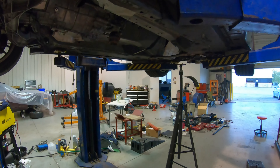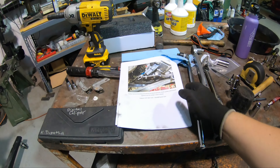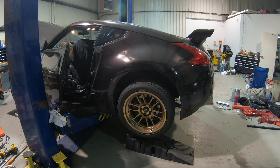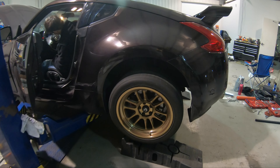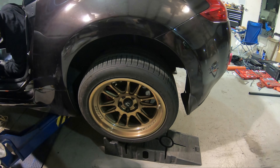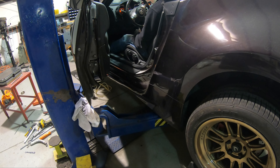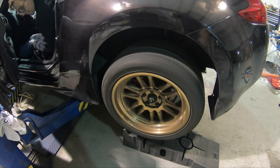Everything is tied up and connected. I zip-tied the harness to the bracket and ran it up through here. I'll cut the excess zip ties, put the drive shaft back in, put the exhaust back, and that will be it. Don't forget your connectors — this blue connector right here. I also need to lower the car, put the shifter back in, raise it, bolt it back in. And of course, when done I'll have to bleed the clutch, but that's nothing compared to everything else.